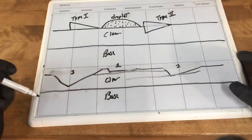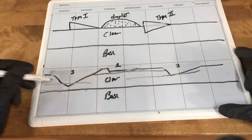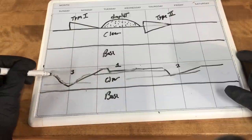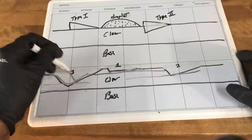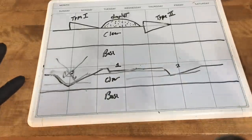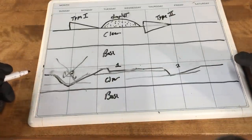Phase three is where the etching is down into the base coat. At that point you're just looking for improvements. Wet sanding will smooth off the jagged edges and some scaling left behind, so the light refracting off the sides of the etch mark makes it a little less hideous. You won't be able to remove it completely, but there can be huge improvements.